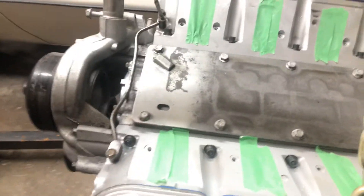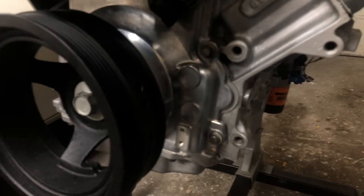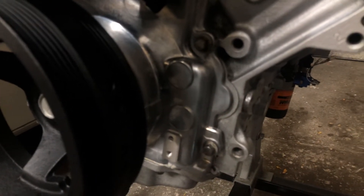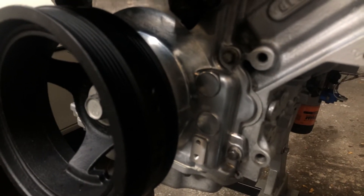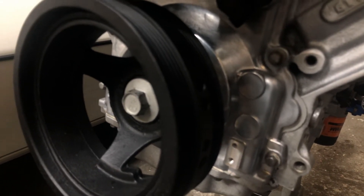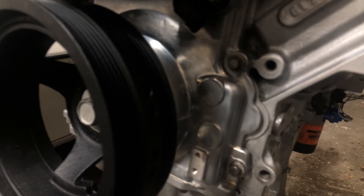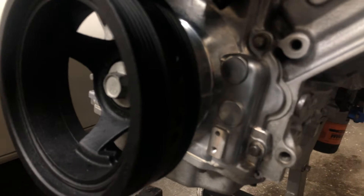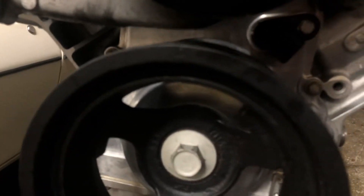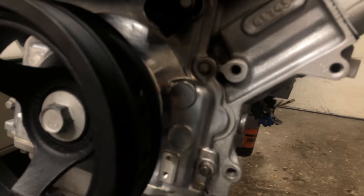Going back to the front of the motor — the last video I mentioned that the cover wouldn't fit properly, and it's an aftermarket cover. It was warped, and I had to grind out these little dimples, and that's exactly where the oil pump bolts are located on the other side of the cover. Normally this cover will fit no problem, even though it was warped. I had to grind those up because I put a high-volume, high-pressure pump in from Melling, the 296 pump, and it's approximately a quarter-inch thicker than the stock pump — the name says high-volume, so obviously it's physically a bigger pump. It actually still fits underneath the stock cover. You just got to grind those two little spots on both sides — there's two there and two more on the other side. You got to grind those off on the inside, take off maybe two or three millimeters, and it's fine because the depth of the gasket makes up the difference, and you're perfect.